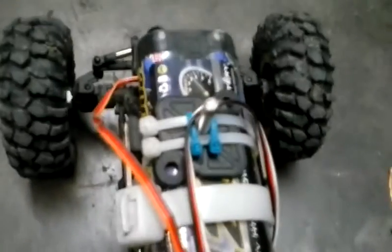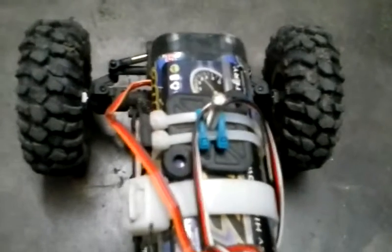Still got the zip ties so I can't take the body too far, but I can show you what's going on. Battery is on the top, more towards the front, connector towards the back. Got my switch right there, power wire ran down below. The electronic speed control is hidden right in there - a nice brushless system. I had to swap around the orange and yellow wires because the motor was running in the wrong direction. Swap those two wires and they'll run the other direction.